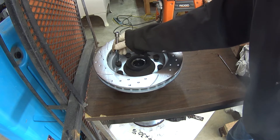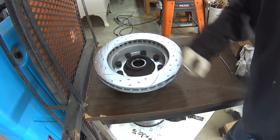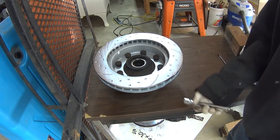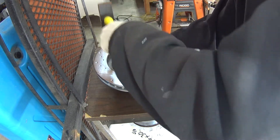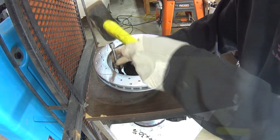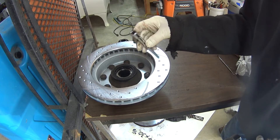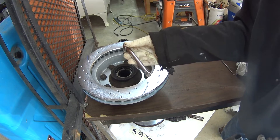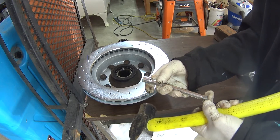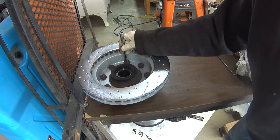They're probably not going to go all the way in — it's a really tight fit — so I'm just going to pound them down as much as I can, and later I'll put the lug nuts on there and cinch them down to pull them in the rest of the way. One thing I should mention: if you use one of these extensions, you're probably going to mushroom the top of it. I don't really care because this one I never use — it's kind of busted up anyway, the bottom part is twisted.